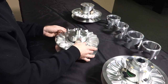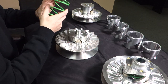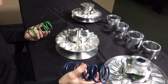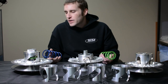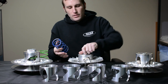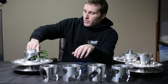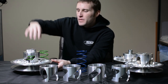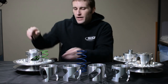The other thing with secondaries are spring rates — we can change how stiff the spring is versus how much the helix is moving on it. For the bigger style clutches — XP Razors, X3 Can-Ams — we're going to use these larger style springs. This blue spring is going to be a 233-337, meaning when the clutch is closed it's at a rate of 233 pounds, and when it's at full shift all the way compressed down it's going to be a rate of 337 pounds.